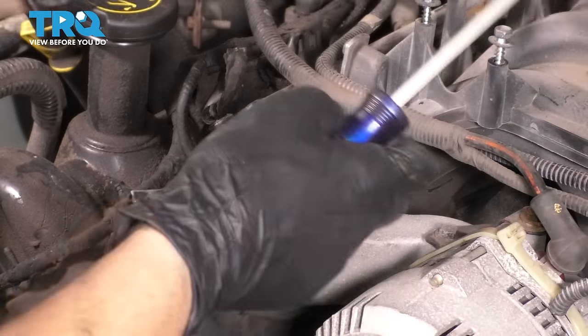Here's what we're gonna do. You can use a piece of hose, and once you lift up the bolt, put the hose about this long, cut it in half, put it around so the bolt can't drop down, or use a wire tie, which is what I'm gonna do. Just wire tie it tight right here, and then it can't drop down into the hole. And then it's out of the block, but it's still in the head, so we can just pull the head out. All right, so pull this bolt up, tie a wire tie around it.